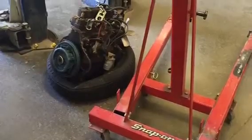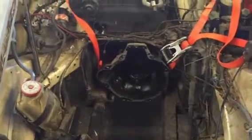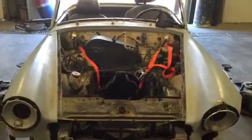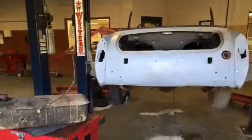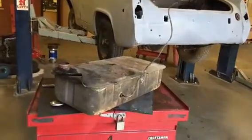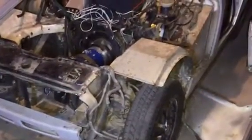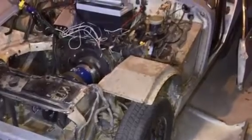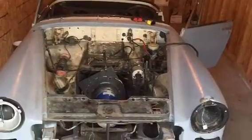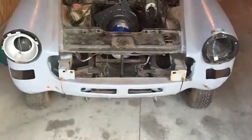It is a tiny engine but it used to work. I kept the transmission because I had to use it in order to mount my electric motor. So I adapted the electric motor directly to the original transmission. I took off the gas tank and the exhaust because I don't need those things anymore. I literally taught myself how to build this electric car, because I had never seen anyone do it and nobody taught me — all of it was self-researched.